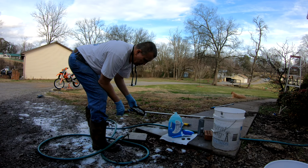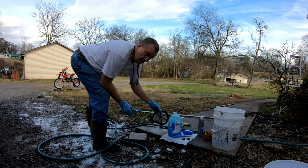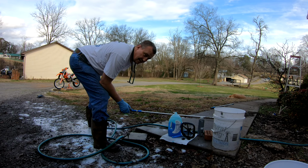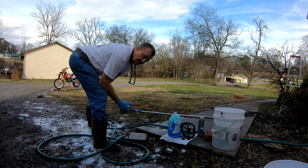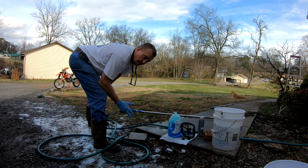And then the air filter, as soon as it gets a little bit dirty looking, just a little, I go ahead and pull it out. I'll oil up a new one and I put it in. And so I think that's the life of our engines, is air filters and oil. So keep them changed regularly, and you ought to have good service out of your engine.